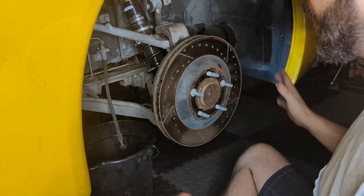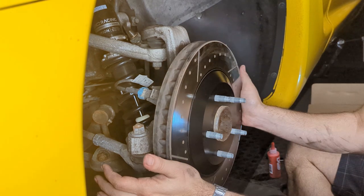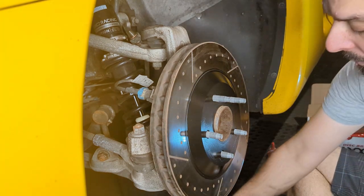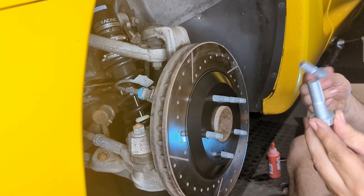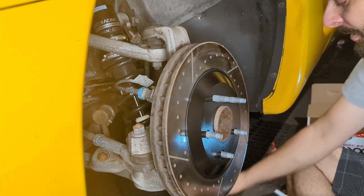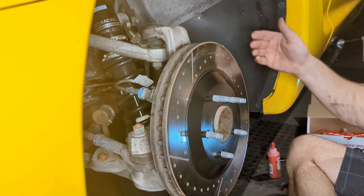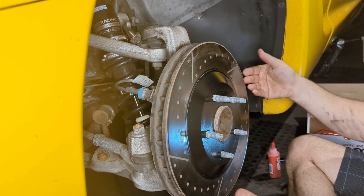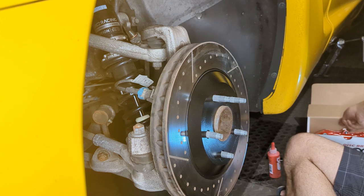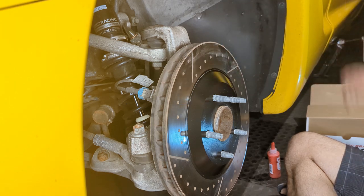It's exactly the same on all four wheels, just mirrored. Front side here. This rotor looks much better, much more pretty. First thing you want to do is get your caliper bolts ready. These were the same as your brackets, but they give you new ones in the kit. You just need one washer for this kit specifically. They give you a whole bunch of different shims for the larger brake kits to make sure the rotor is perfectly aligned inside the middle of the caliper. For this kit it shouldn't be an issue. Both calipers for the front are the same — fronts work on the fronts, rears on the rears.